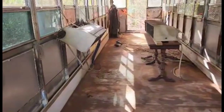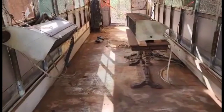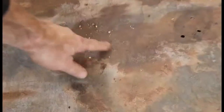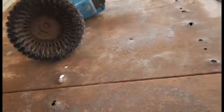This is the emptiest the bus has ever been. The air conditioner is dangling over there from the side. The other one should be okay with the floor — it only touches in a very few points, and I can move things around when I need to. I'm using a wire wheel brush and it's cleaning all this rust up pretty slick. It's making a lot of dust. We have the fans going, the windows open. That's my seven-inch giant wire wheel — rough enough to scuff this pretty good.